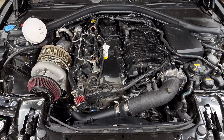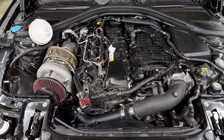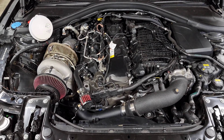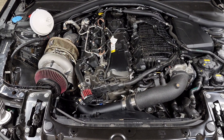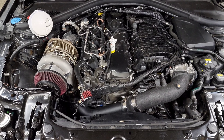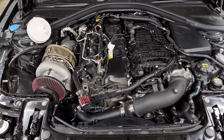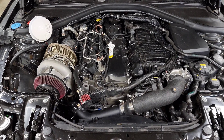The thing you need to be aware of with E85 is it is more corrosive than gasoline. While gasoline has pretty good properties that lubricate your fuel system, E85 is lacking those benefits. On older cars it's very common to need to upgrade fuel lines and different components in your fuel system to safely handle E85, otherwise it can cause things to rot out, leak, and fail over time.